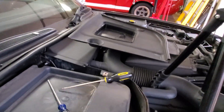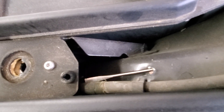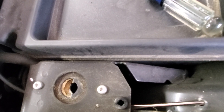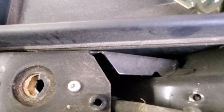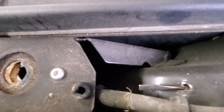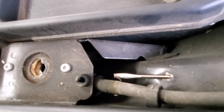This allows you to get in here. For some people there's a hose or wiring loom — actually this is the main power cable coming from the back battery. A big disadvantage to drilling a hole further down is that you can hit your battery cable, plus you end up with a big hole in the car.